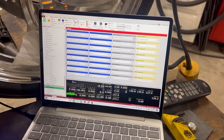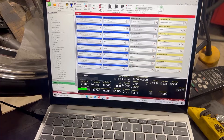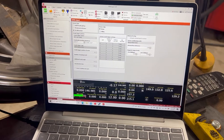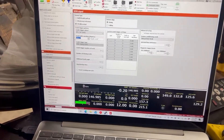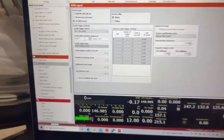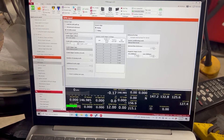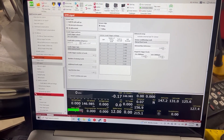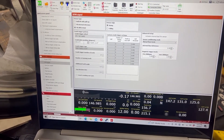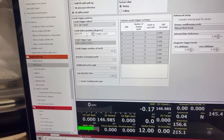I need to calibrate the ignition. What we are adjusting — or not adjusting, depending on what your crank index position is — is this number here. Crank index position is 102 degrees on this bike. I checked this bike last year when we had it running, so it should be the same. We didn't open the motor at all; we just had to take it out for some mock-up, so that number should stay the same.